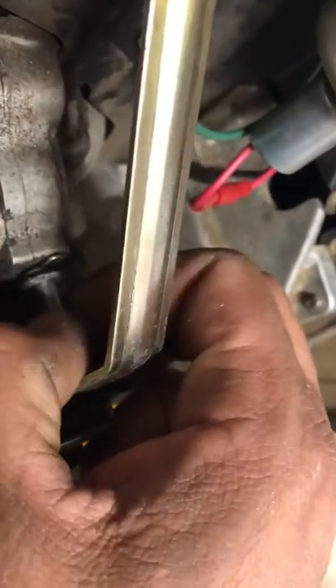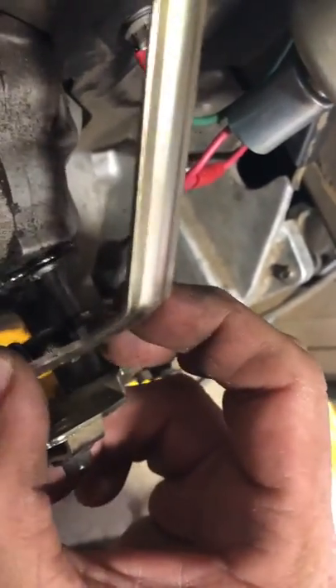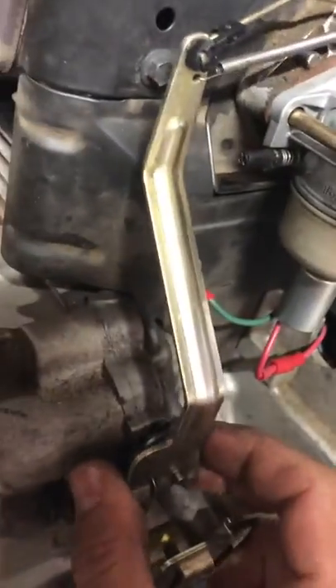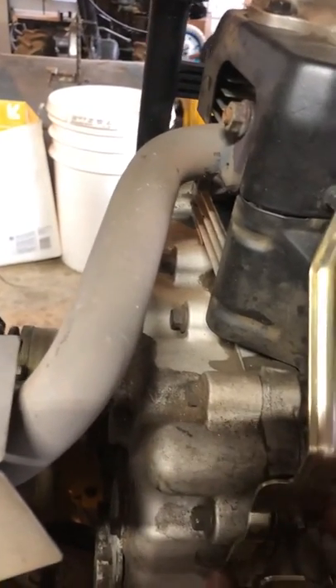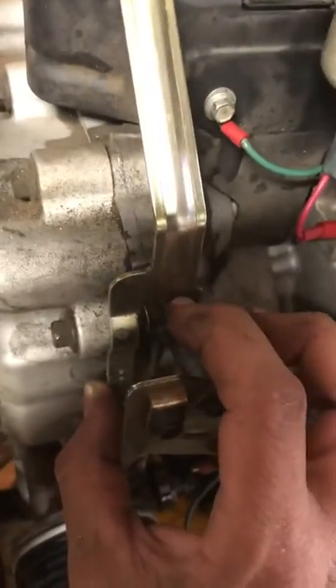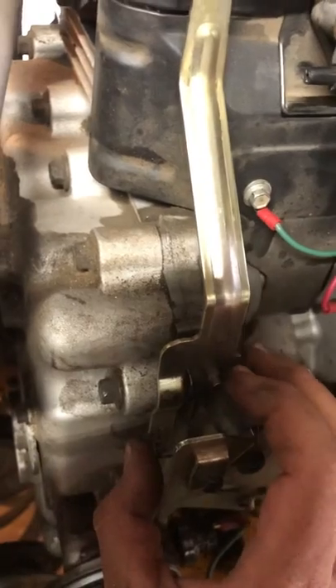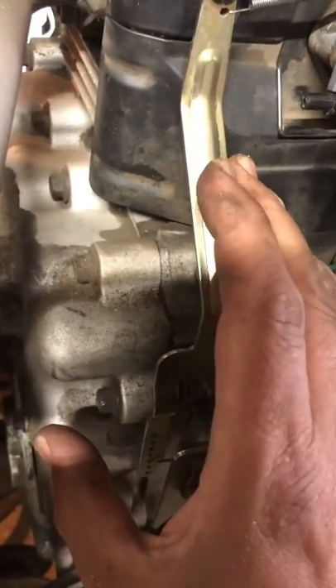Here's the governor. I'm wondering if this governor pin has something wrong with it, but it spins back and forth. It's got a little cotter pin so it doesn't slide out, and a little washer. If you take the governor lever and set it in there — moving it up and then moving this all the way over in the counterclockwise position — that's what the Kohler handbook says, with the throttle depressed to full throttle.